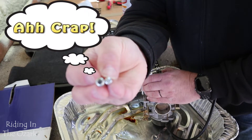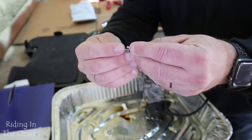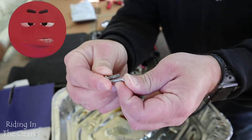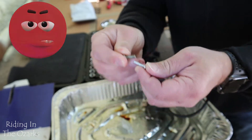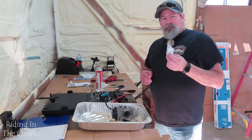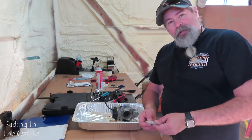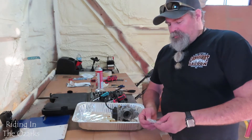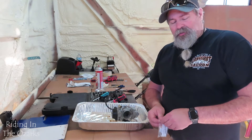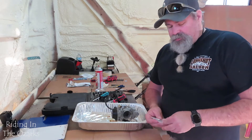I'm not sure these screws are going to work — the head's a lot smaller, and the bolt's smaller too and it's longer. Last time we were filming I had the wrong screws for this carburetor. I believe I have the correct ones now, which are M5 14mm. I bought 10 of them, and I bought socket-headed ones instead of the Phillips screw ones to put back in here. We'll see if these are the right thing now.